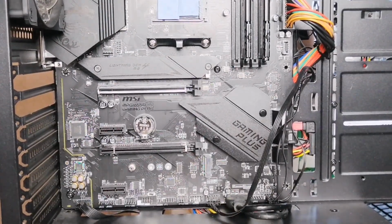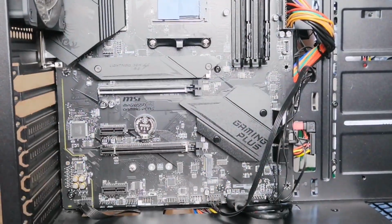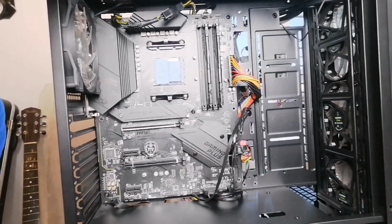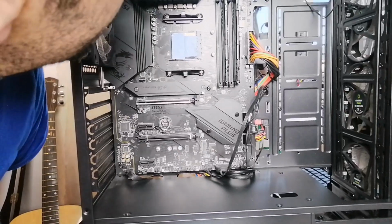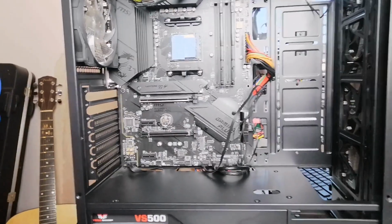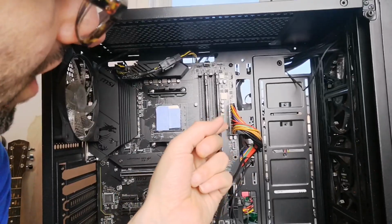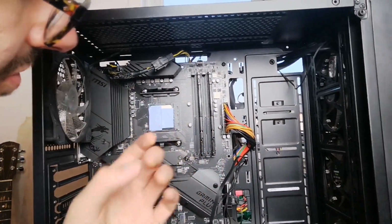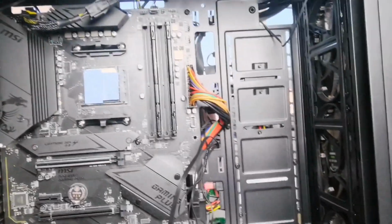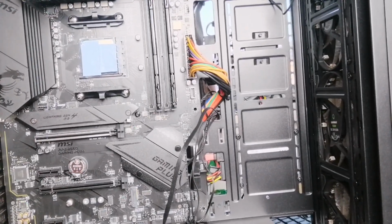So now I'm just going to try and turn it on and POST this system without putting on the display, and see if it's going to give us any error messages. So on most motherboards now, it posts within the board itself, and any problems it lights up on a 4-point LED system. I call it the error system here. So you can see that over here.